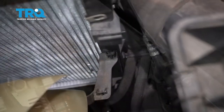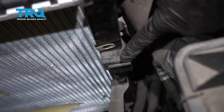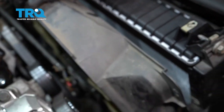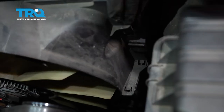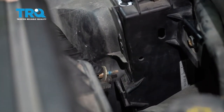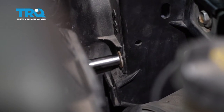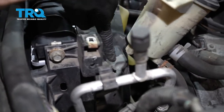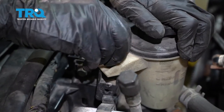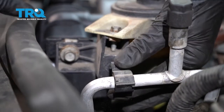Let's go ahead and grab onto that upper fan shroud. We're going to slide this upper fan shroud down onto the lower one. We have these little pitons that stick out — make sure those line up right along both sides of the vehicle. Carefully slide this down and get it into position. Once it feels like both sides are semi-lined up, press it down to lock it in. Now let's put in our side bolts. Pay attention to the lower aspect — there's a little nub that needs to fit into the hole in the fan shroud. Get it in position, start the bolt in, and snug that up as well.